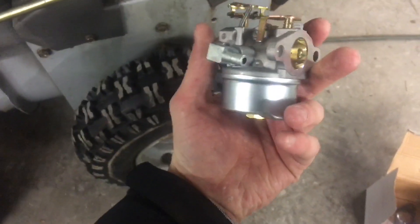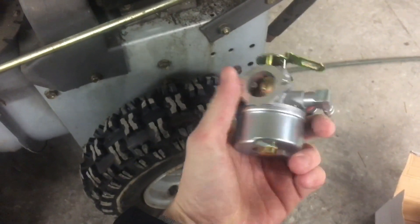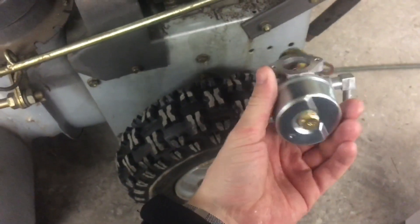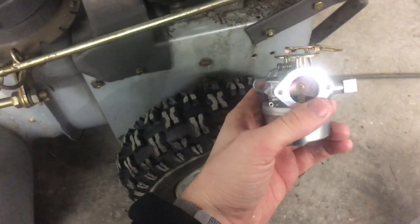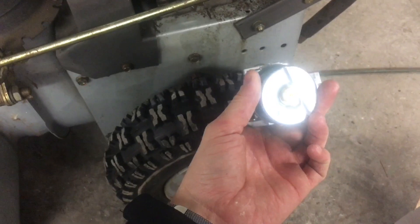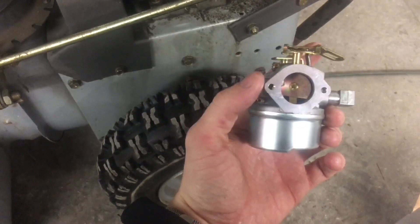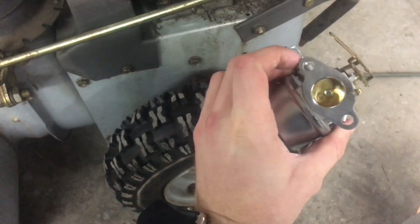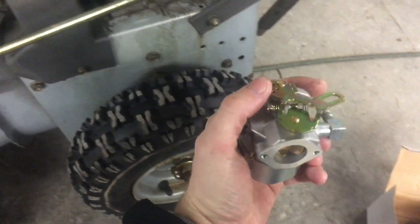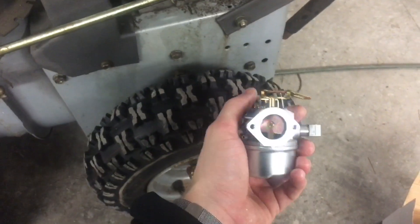So as a last-ditch effort — since this blower really isn't mine anyway — I bought this replacement China carb for it. It was about $10 shipped and says it fits Tecumseh 4 and 5 horsepower engines. It looks pretty similar; there are a few little differences — there's no easy drain to get all the fuel out of the bowl, which is a little unfortunate, but it's still pretty easy to empty out in the fall or spring.